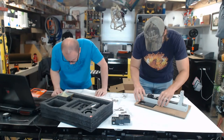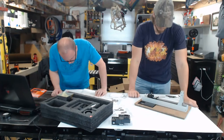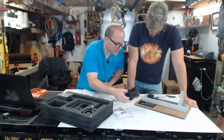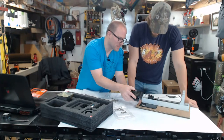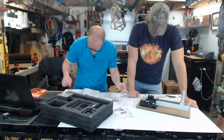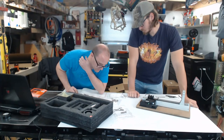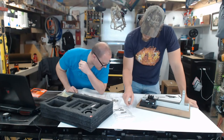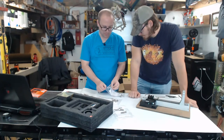All right, so continue using the enclosed cardboard to have the back plate lifted from the desk. The reason is that the power button on the PSU will be facing down and might get damaged. So the little power button is going to go through this little hole here. You're going to flip it this way, so it needs to be lifted off. That's why you're using the cardboard. Then there's three holes. We're going to connect it with M3x5. Finding screws is the most fun part. We have some in here. All the screws are in separate bags.